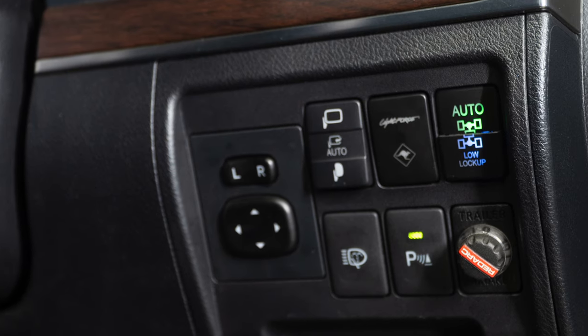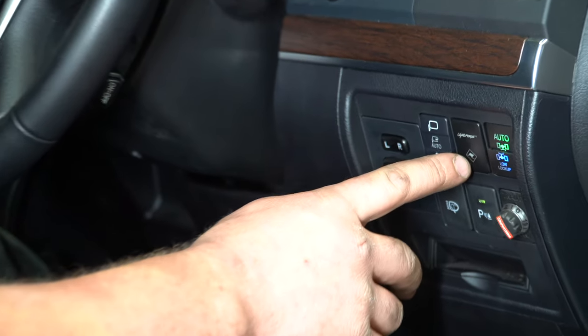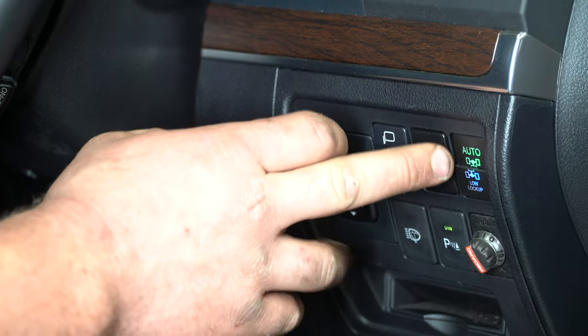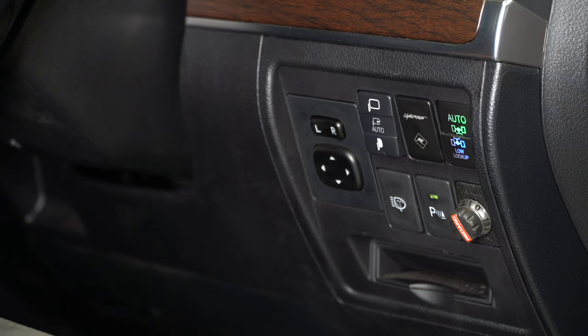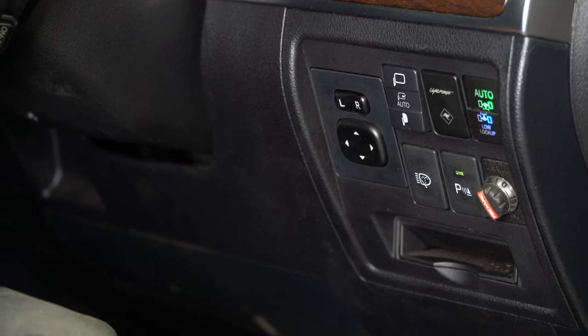On the driver's side, it's come up nice and neat and clean. There's a Lightforce universal 200 Series switch for the spotlights, and right next to it you'll notice the lock-up kit — he's opted for the Torque lock-up kit, which is fantastic for highway driving. It kicks in a bit earlier, drops the revs down, and you save so much on fuel — it's really economical.